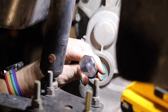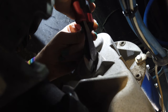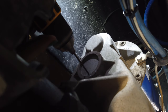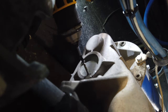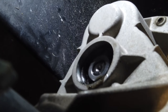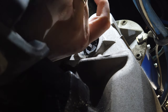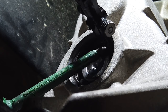We come over to this dust cover and this thing was a lot tougher than I ever thought it was going to be. I had a mechanic friend on the phone helping me out. I tried to get it out by prying it out for far too long. The easiest method here is just to drill a hole into it - you can drill it in the center so you're not going to compromise any of the bearings on the inside, but you'll likely need to order a new set of bearings and a new cover for this side and the other side. I just drilled a hole, used a machine screw to start it in, and then the cover popped right off. And once again we're back to snap rings - you've got to get the snap ring out to get the bearings out and slide the shaft over. This time I went with an upgraded pair of snap ring pliers.